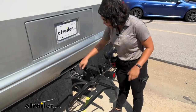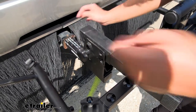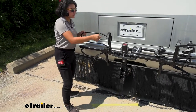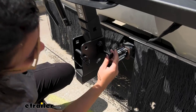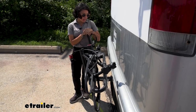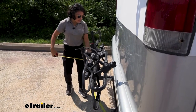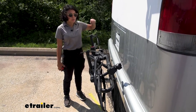Now we're going to fold this bike rack up for when you're parked at the campground and don't need it. You start with this knob — fully remove it, then once it's clear you can pop out that bolt and fold the rack up against your motorhome. There's a stopper to line it up so you can pop that bolt back in and tighten it down easily. There's about three inches of clearance between the bumper and the bike rack, and with it folded up the length added to the back of the motorhome is only 12 and a half inches — a big difference.